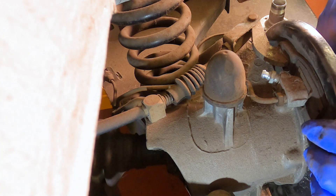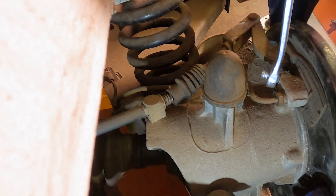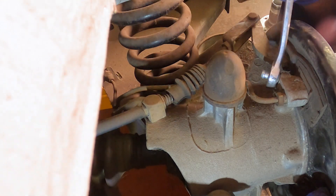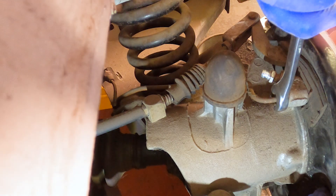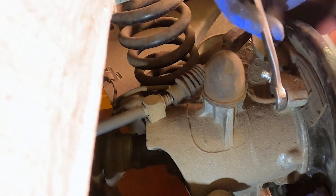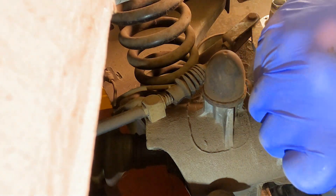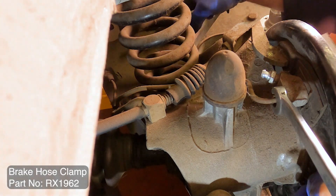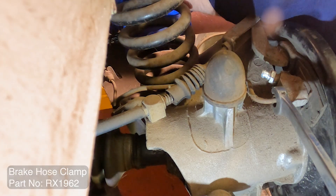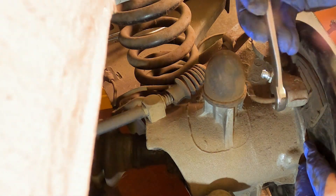To remove the brake cylinder we need to first make sure that the bleed nipple hasn't seized, so we can bleed it afterwards — and that's absolutely fine. Next we need to check the brake pipe unions. That's come loose, lovely. So before we undo that any more we're going to clamp up the brake pipe using this brake pipe tool. That'll stop any fluid loss. I'm just going to clamp on the flexible hose and when we undo this we shouldn't have any fluid loss.